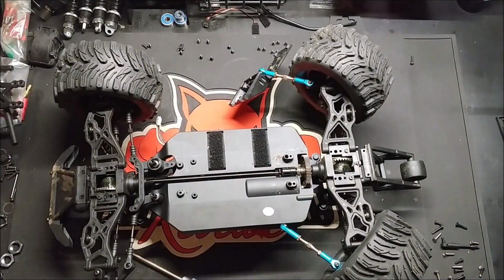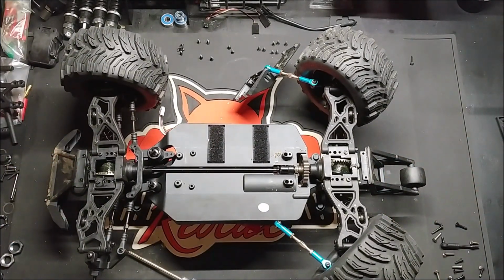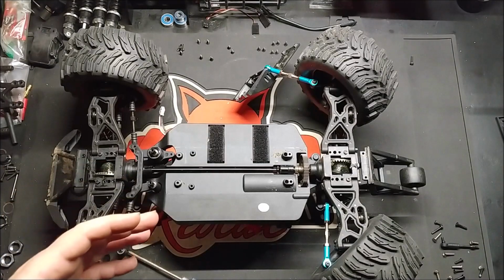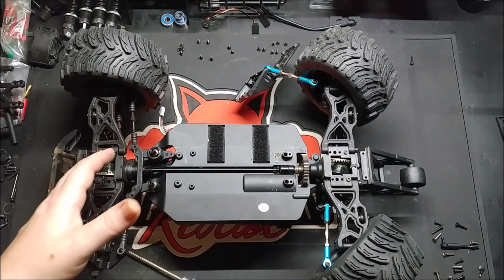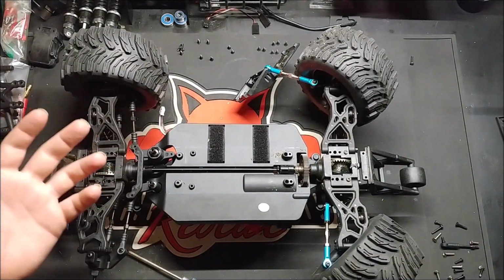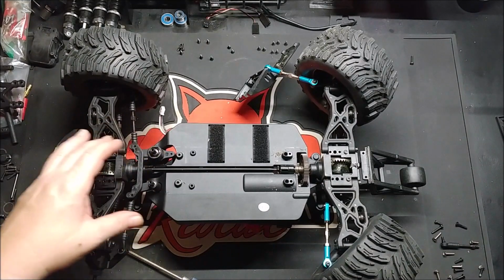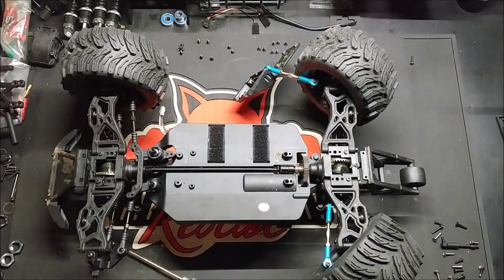Oh, gotta take the front off now. Nice. Man, I'm telling you what. Ease of access so far, I'm going to give it an A-minus if I'm grading. I mean, things like this are always a pain in the ass, especially with the Volcano, trying to adjust the servo saver and the nut that was on there. Just to access it, if the screws on the bottom start to come out wrong, like the Caldera, Earthquake, all of them were really difficult to get to if you had to access this. I mean, this takes it right off. I can take these links off here, take the screw off the link on the top, and I can have my whole servo saver out in a matter of a few minutes, which is a good thing.